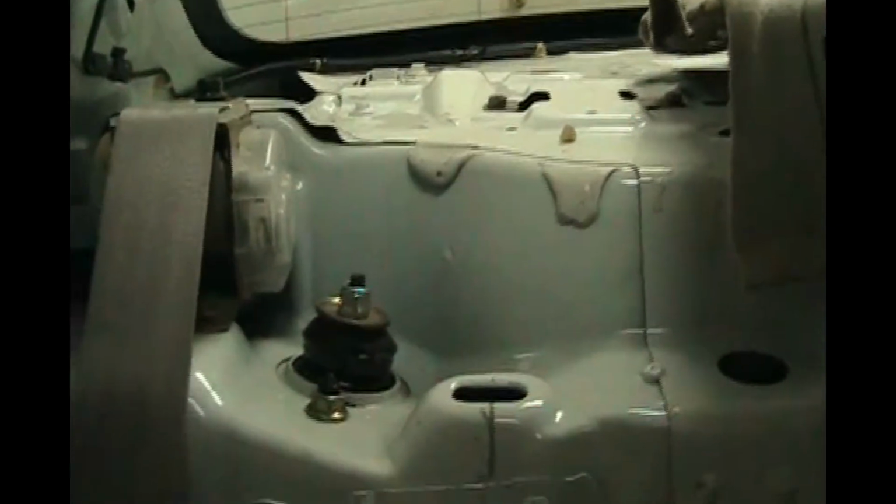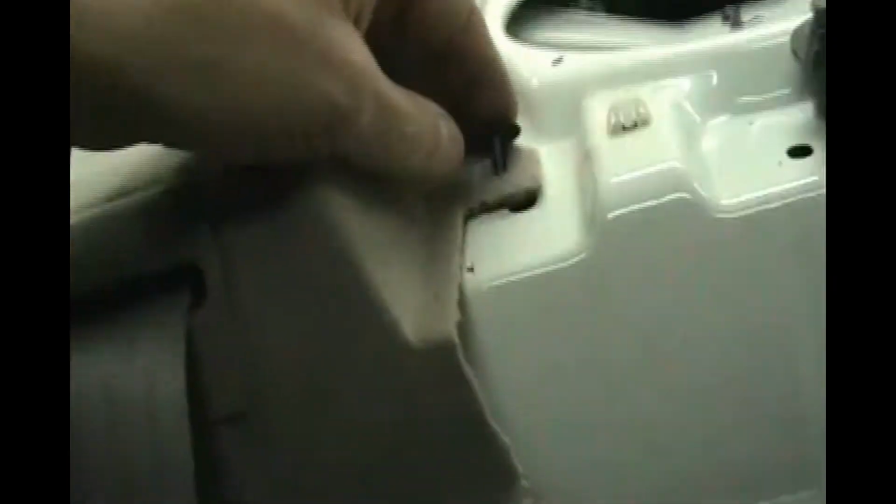Do mostly freeway driving. Okay, so first thing you want to do is thread your seat belts through this slot and make sure they're not twisted, and do it for both of them on the passenger side, and then get it lined up with these push pins that go in the small holes there, not the large hole, but the small hole. So you want to push it all the way back against the glass and then line up the push pin hole and pop it in there.